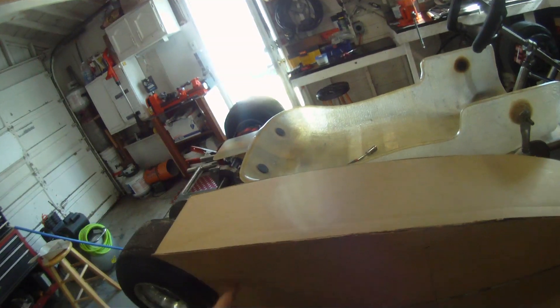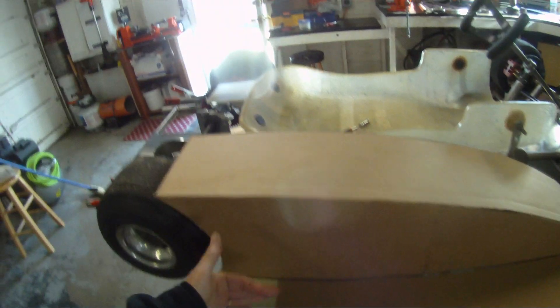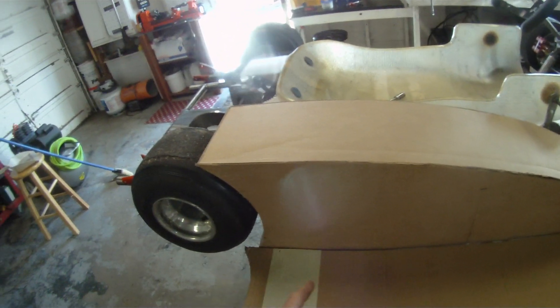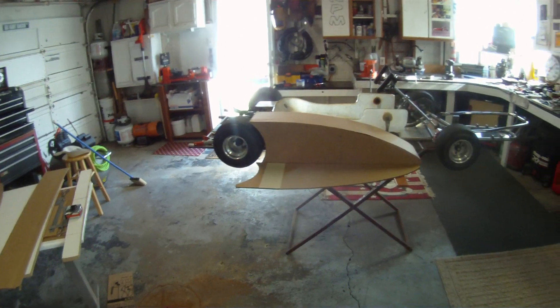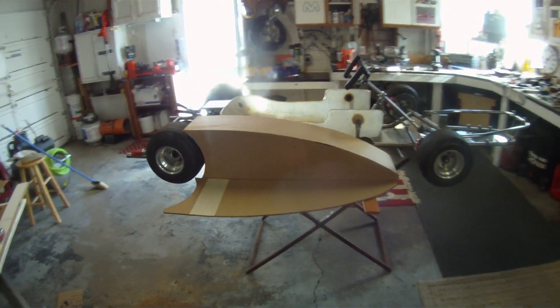It won't transfer anything from the original piece up through any primer and paint. Because when this thing sits in the sun after it's been completely done — primer and paint and everything — if you've bored a hole in it and patched the hole and did some Bondo work on it, prime and paint, as soon as the thing sits in the sun and gets hot, the fiberglass is going to react differently than that polyester filler. You'll be able to see it — you'll see the ghost marks, you'll be able to see everything you've done. So you've got to be very careful what you use to do body work on this raw glass.